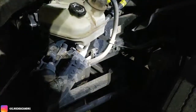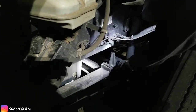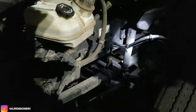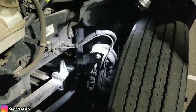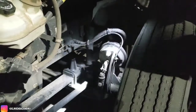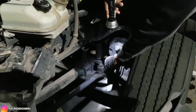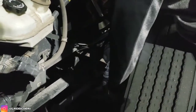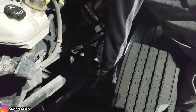We're gonna check the U-bolts — we have two-piece U-bolts: properly secured, no cracks, not broken. Check the shock absorber: properly secured, both ends, no cracks, not broken, not leaking. Check the brake chamber: properly secured, no cracks, not broken, not leaking. Check air lines and hoses: properly secured, both ends, no abrasion, no cuts, not leaking air. Check slack adjuster and push rod: properly secured, no cracks, not broken. With the brake released, by hand the push rod should not move more than one inch.